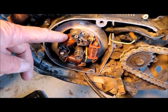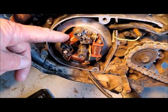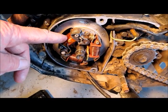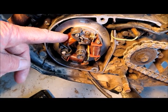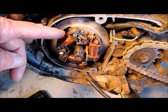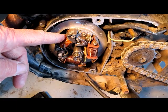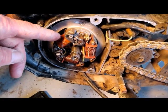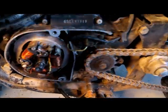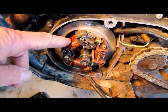So I tested the wiring going to the coil, and the shop manual for this bike says this coil — the ignition coil inside the magneto stator assembly — is supposed to be 1.0 to 1.6 ohms, and it was about twice that, almost 3 ohms. I took this out of the bike and tested it away from any wiring, exact same reading — almost 3 ohms.